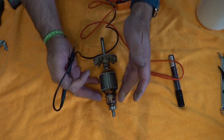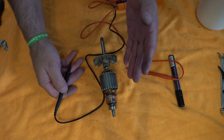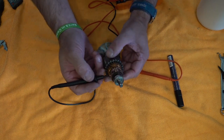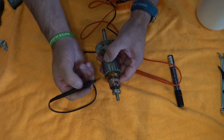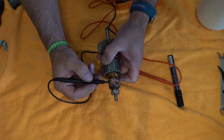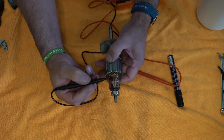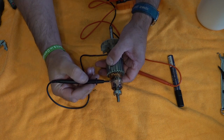If you get a spike, you've got broken or burnt out wires. If you get a dip, you've got a short in between them. The second test is bar to bar — again you're looking for readings of 1.2 to 1.4, so they're pretty close. I have already marked this armature so you'll see the marks and understand why they're there as we go through the video.